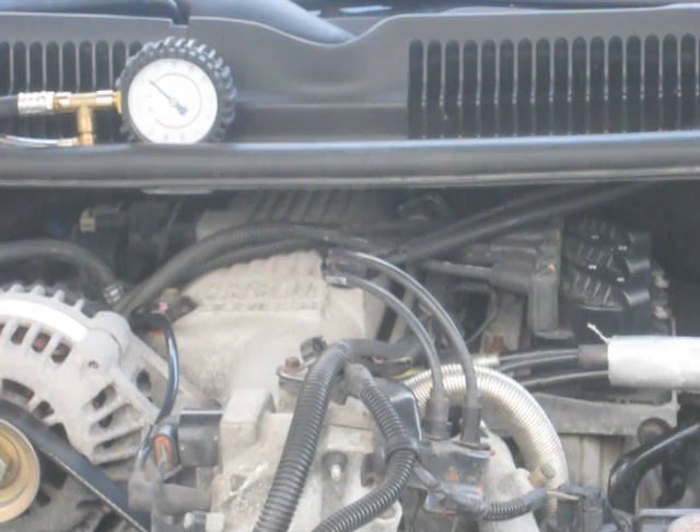So what is causing this quick drop off in fuel pressure, and why is my fuel pressure so low? It could be the check valve in the pump, or I could have a hole in one of the lines in the tank — kind of like drinking with a straw that has a hole in it. It's possibly that, or maybe a leaky injector. With the bleeding off as fast as it does, I'm not so sure it's that. But it could be the regulator, and I just replaced that, so maybe the regulator's faulty.